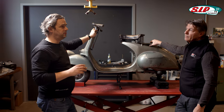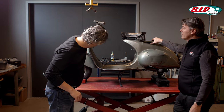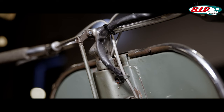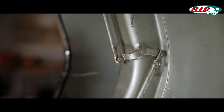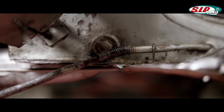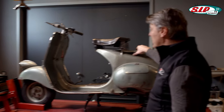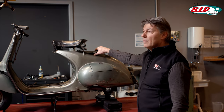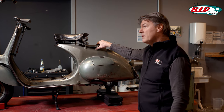The next major change is the gear shift. At the very beginning the gears were shifted via rods — a rod goes up and down and a wire goes on to the rear of the gear selector box. This was built like that until the last V15 series, until the end of 1950. A little longer in license production at Hoffmann — until 1953. But the Italians ended it with the V15 series in 1950.